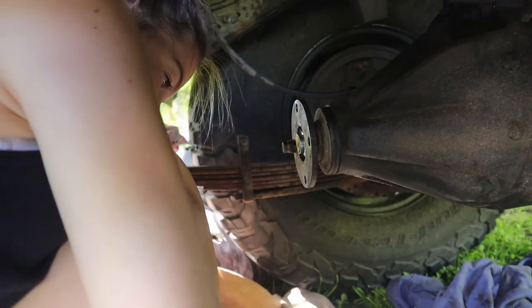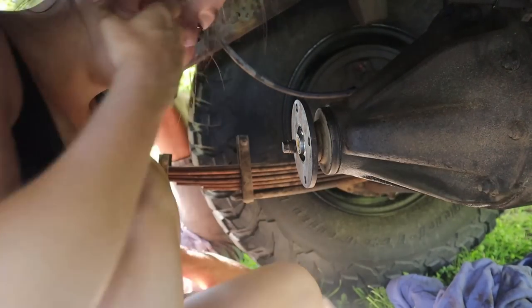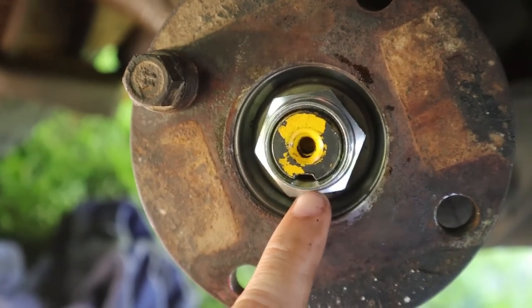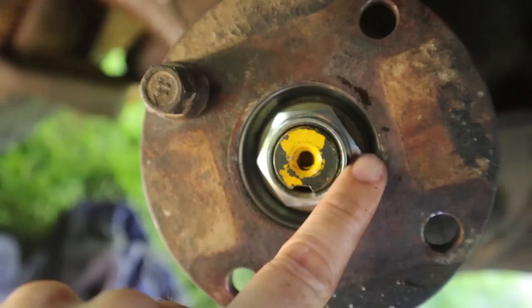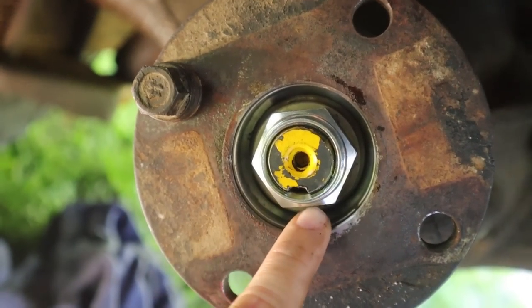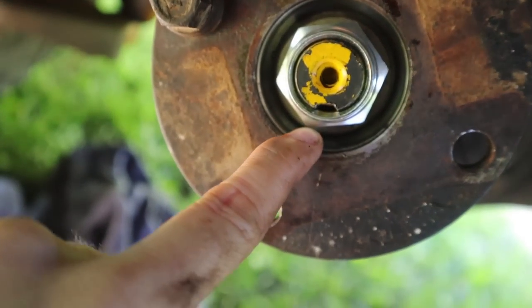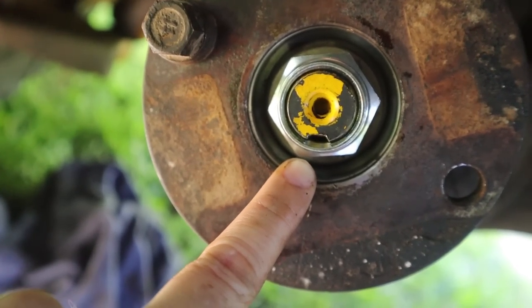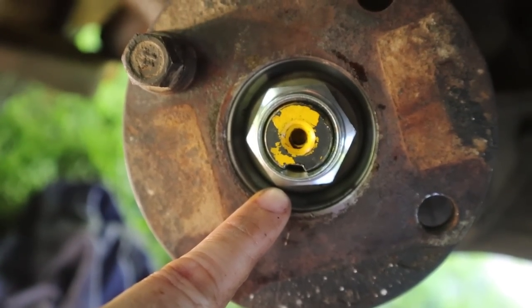Yep. Fine. Need a couple of mil length. I think that'll do. Because we're not replacing the crush washer, you don't want to go more tight because you're going to load up your crown wheel and pinion and cause all sorts of dramas. So we've just gone maybe 3 mil more. We'll see how that goes.